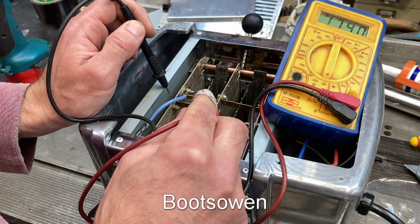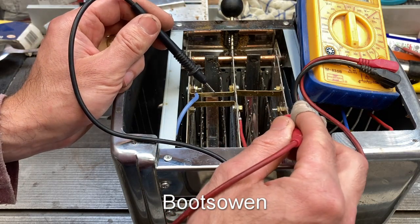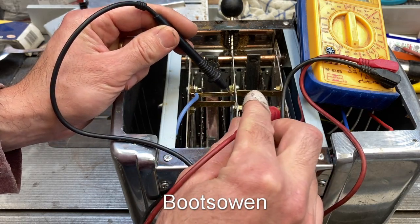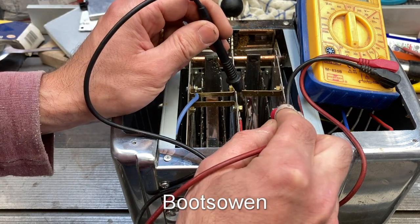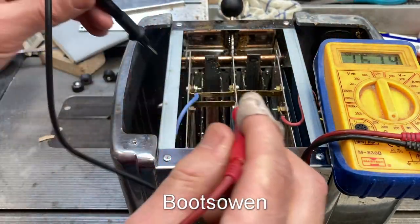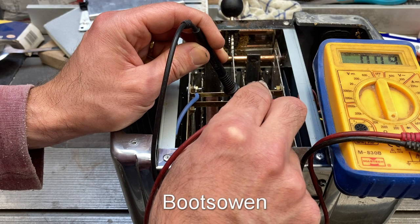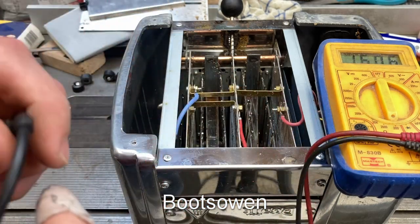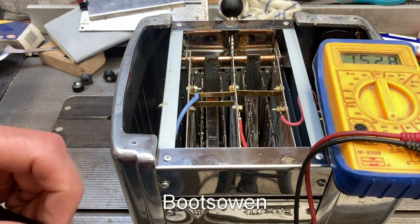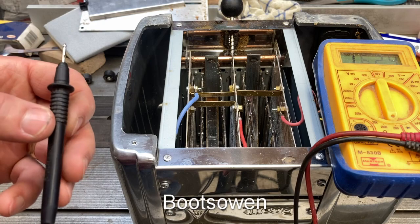So that's your one slice, which is permanently coupled. And then over here, it's not coupled. You've got two lives coming in — one goes to here, which also goes to here, because it's connected with this brass piece. This one is separate. So if it's onto two slices, these two should have a continuity across the switch — less than one ohm. These two are always connected. I've tested it by heating it, and I'm convinced that it's working.